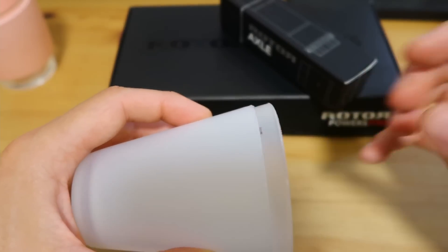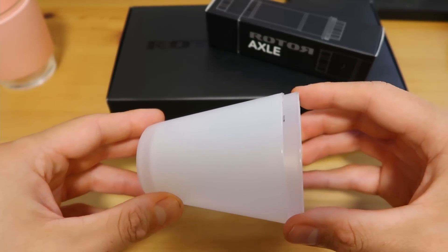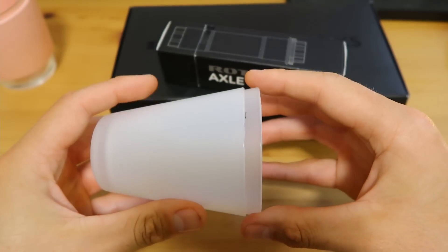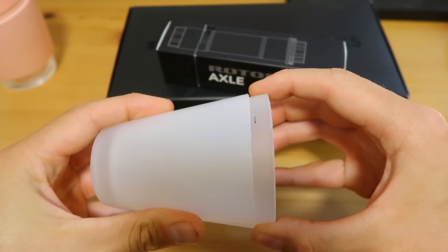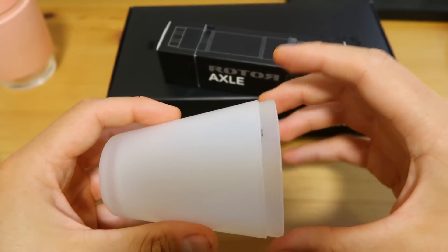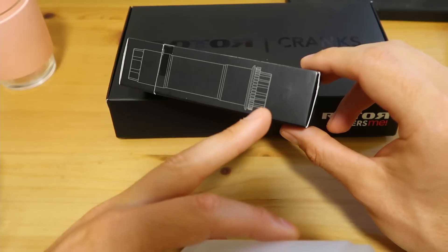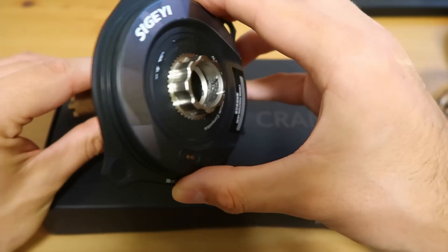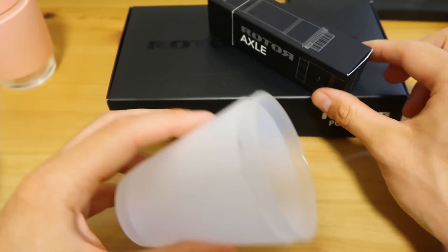In a perfect world you need the same force to disassemble tapers as you did to put them together. They're great at mating two things together, but what is very hard to control is the final axial position of the two halves — depending on the tolerance of the two mating halves, the angle, and the diameters. You could end up with the tapers being locked here, or there, or going a bit further in. The finer the taper angle, the higher the possible discrepancy on the final axial position, and that becomes very vital on the drive side because you're trying to lock down the chain ring spider and the power meter while also getting a perfect mate at just the right time on the drive side spline.